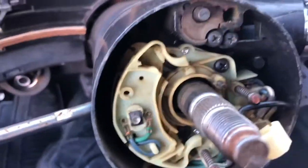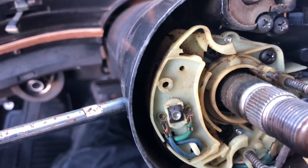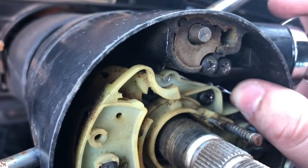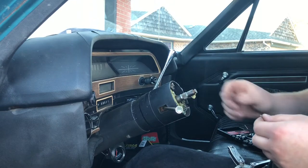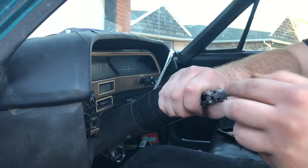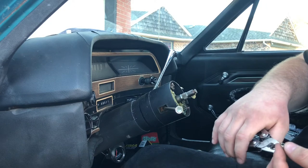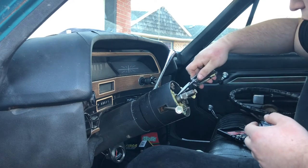What you're going to do is turn this to accessories. This is if you have the key and can turn the ignition cylinder. I'm going to put this paper clip in and push up — you push and pull on this cylinder so that while you're pushing on this pin, you can work it out and it'll pull right out. Make sure your lock is not locked — make sure it's turned into the accessories position. In my case I just turned it a little bit because I have no clue what the accessories position is on this car since I haven't run it yet.